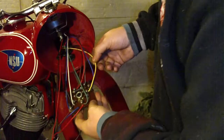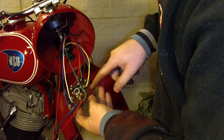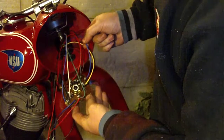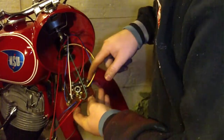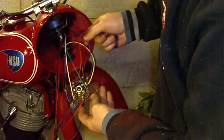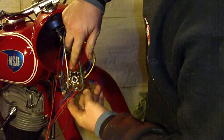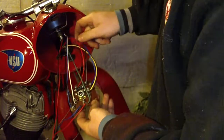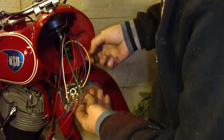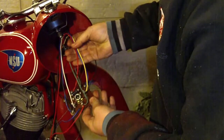You will also have three connectors on the power generator, and one of those three connectors has this marking also, so you cannot make mistakes. And you have this blue wire, it is 61, and as I said, on the power generator you also have 61 marked, and you connect this wire. And you have this wire. Now this wire is connected to 30-51, same as marked on the power generator. So you have these three wires that are going to the power generator on the engine.